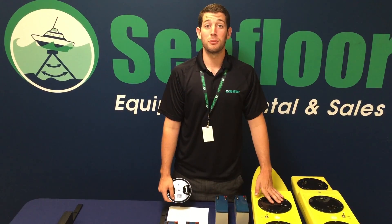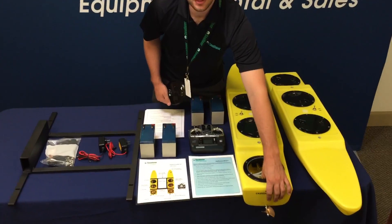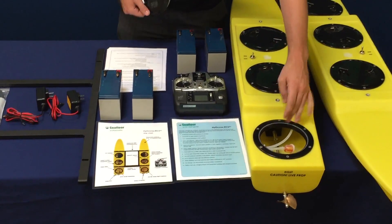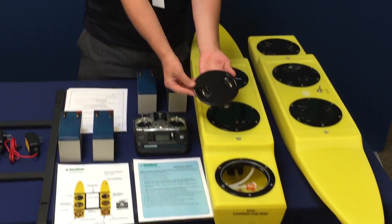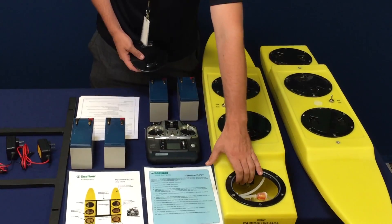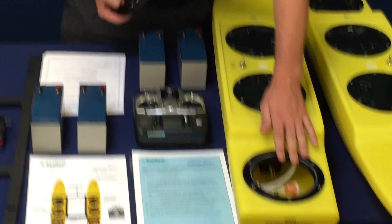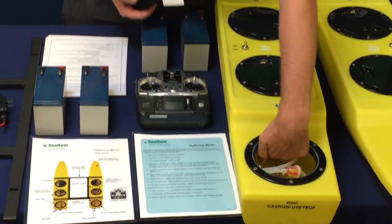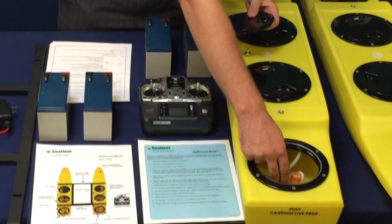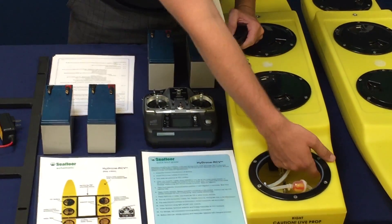Now let's take a look at the internal components of our boat. We have a 65mm propeller with an internal shaft. There are three black hatches that allow you to get into the internal components. With this rear hatch, you see the internal shaft, the back end of the motor, the water pump with both a water filter, and the inline going up to the speed controller.